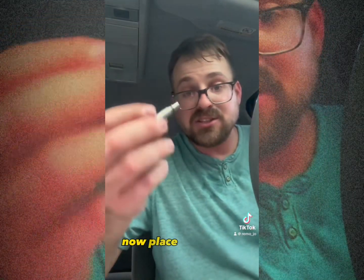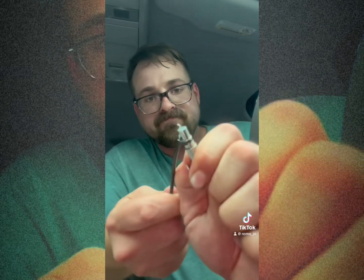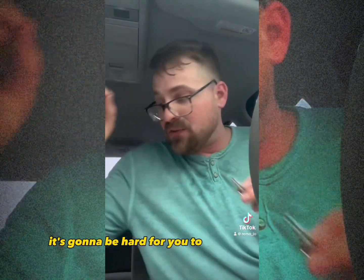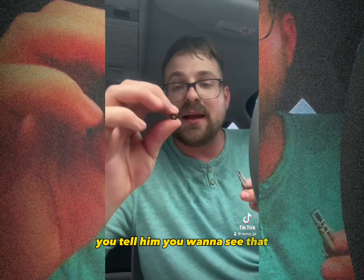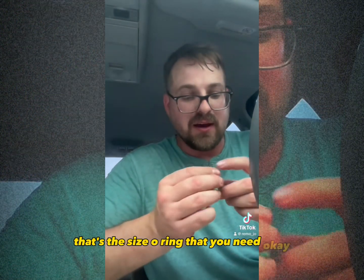Now, place your O-ring. Get your pick under your O-ring. Pop it off. That one actually broke in half. Now, if you look online, it's going to be hard for you to find this O-ring, okay? The right size, if you go to O'Reilly Auto Parts, they got a little red box of O-rings. You tell them you want to see that. And when you open it up, there's going to be a size called .008, 008. That's the size O-ring that you need, okay?